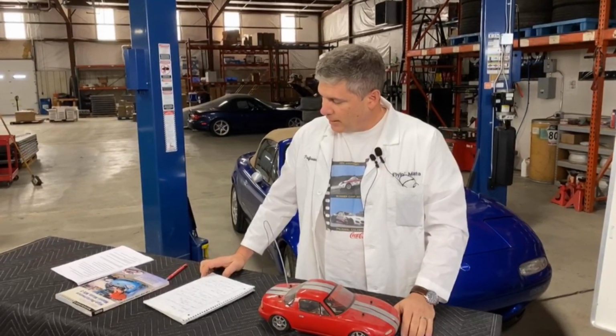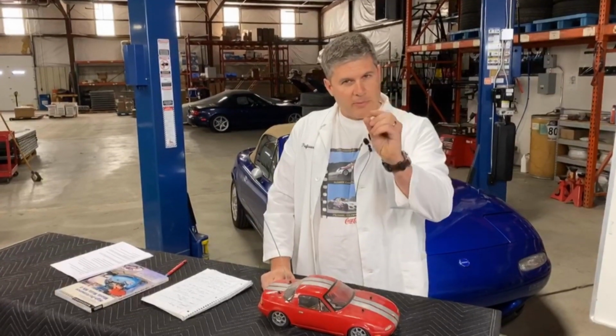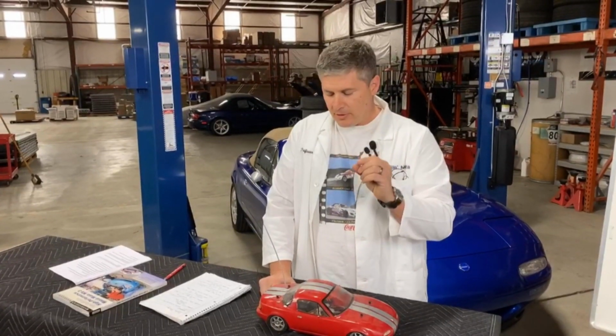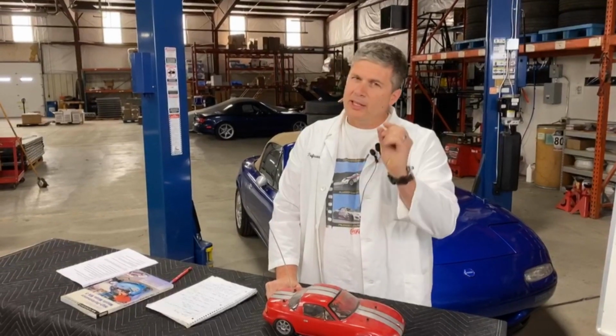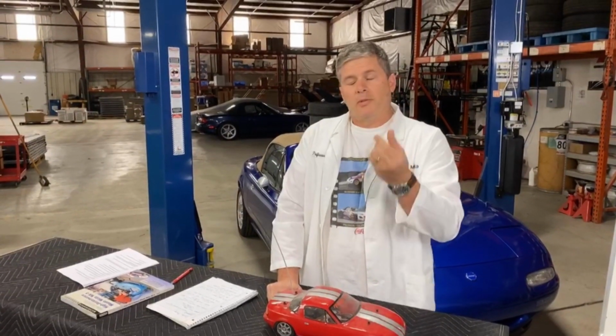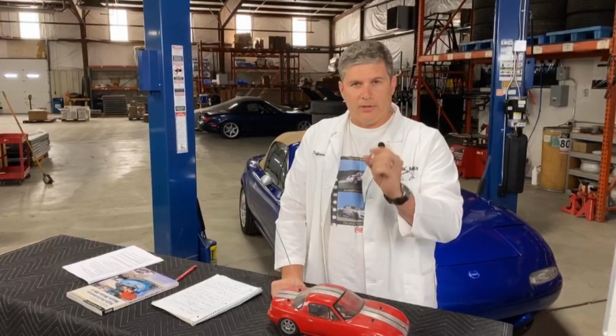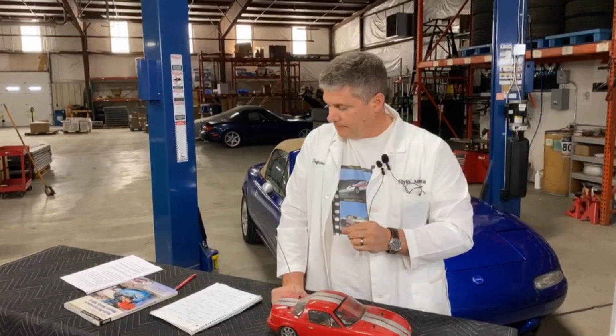This is also why, I don't have a sample here for you, the thickness of your brake pads is important. If you're going out on the track and you've got some pads that are pretty good but they're getting a little thin, they can't absorb as much heat because there's just not as much pad, there's not as much material there. And so what's going to happen is those pads will get hot, it'll get into your fluids, and you're more likely to boil your fluid than you were if you were running full depth pads. So if you fail a tech inspection because your pads are too thin, that's the reason, because it's working the rest of your brake system too hard.